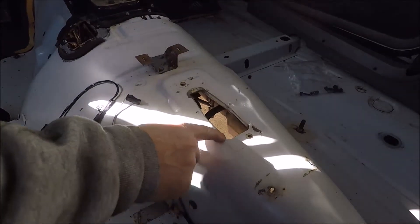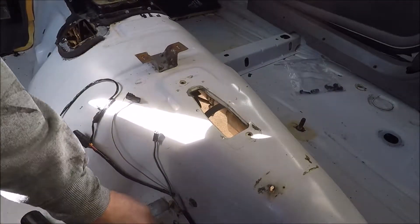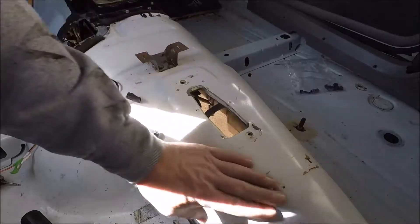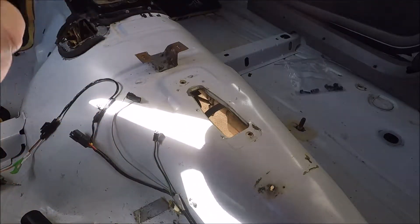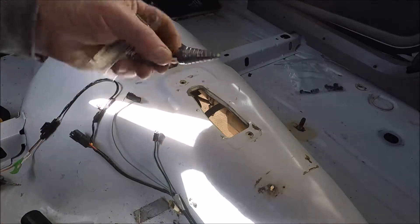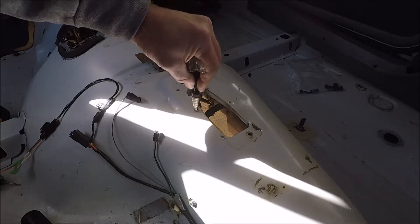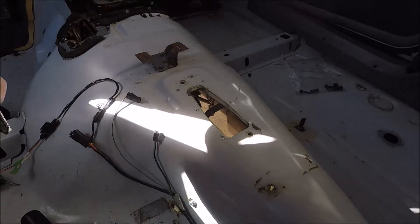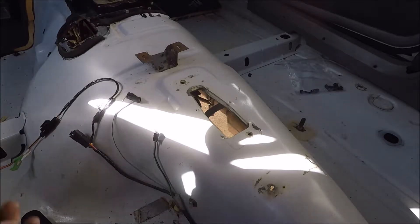I have drilled little 1/8 inch holes. The lighting's not as good in this truck, it's kind of underneath the awning. This is the body I'm keeping, so I kind of don't want to make any bigger holes than I need to to get that plate off. I'm going to use a step bit so that when I go through, it's only going to remove the amount of material I really need to break it loose. That way hopefully I'll have smaller holes to worry about.